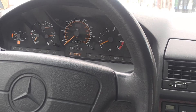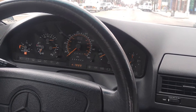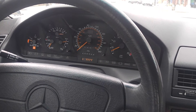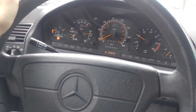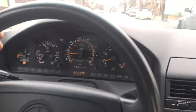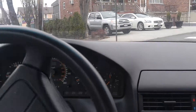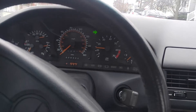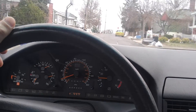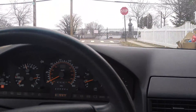I know it's going to be a long video, but I want to document what I'm doing here so you know what you're getting — a nice working module. RPMs are fine. Cruise control won't activate from standstill; you have to be going about 20 miles an hour or so. Acceleration is fine. Everything drives just the way it's supposed to. I know this module is proven — updated capacitors just as a proactive measure — and I drove on this module for quite some time.